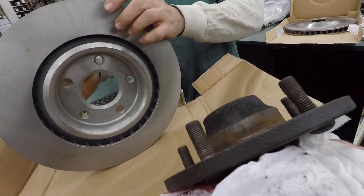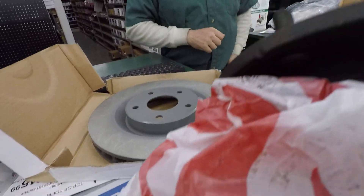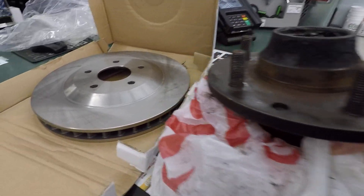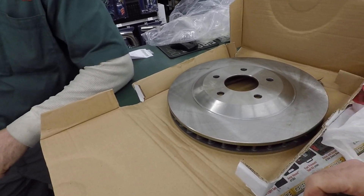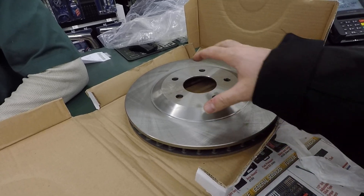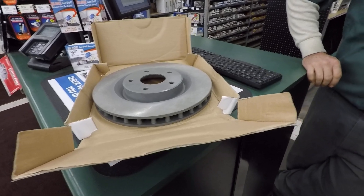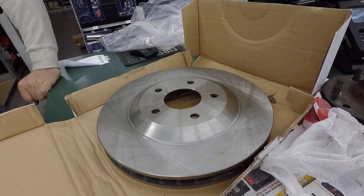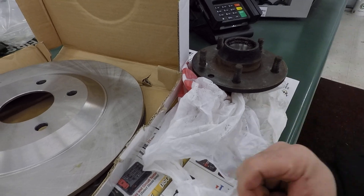I think what we're going to do is tear this hub apart some more. We're down here at O'Reilly's and my brother works here, so he thinks he can mount this in the brake lathe and just turn a little bit off this edge right here so it'll fit. Anyway, just wanted to make a comparison on these different rotors, because I had heard the hats were different between C5 and C6 — and they totally are. I'll get you guys the next video when I hopefully have all this stuff together and we can put them on, or maybe we'll video turning this down.